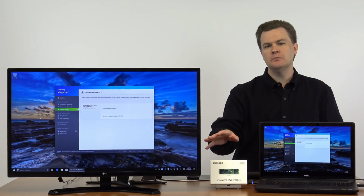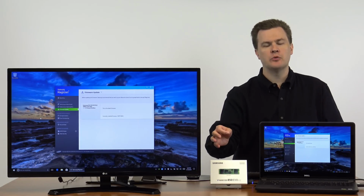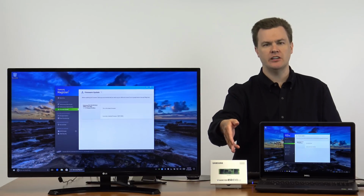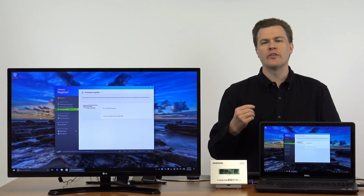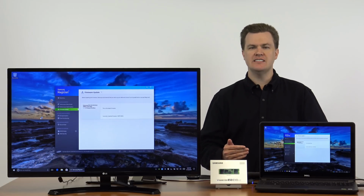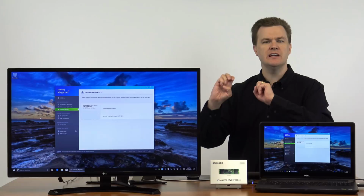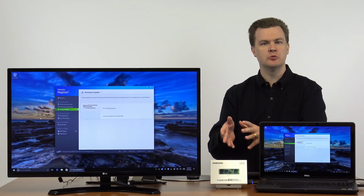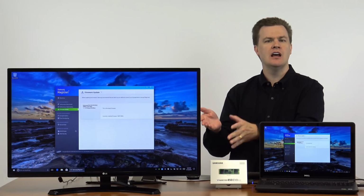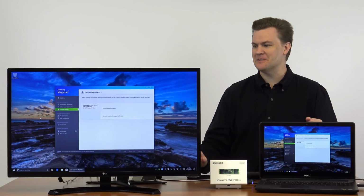But it's worth checking because there is, it's driver software that is called firmware because it's physically on the SSD. And SSDs more than hard drives often have firmware updates. About half of the SSDs I install in all the computers you see on my channel need a firmware update. So whatever the program is, be it Storage Executive from Crucial or be it Samsung Magician, it'll enable you to update the firmware on your SSD. So many things to update in a computer, isn't there?